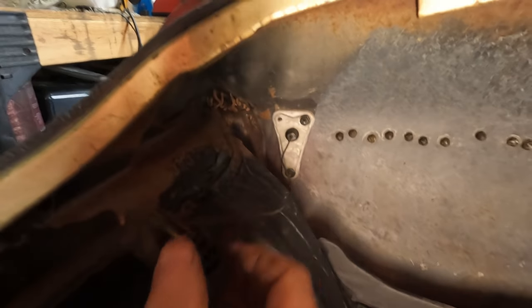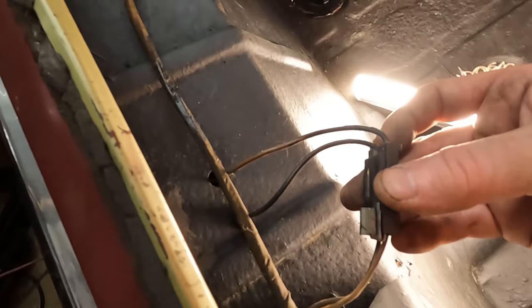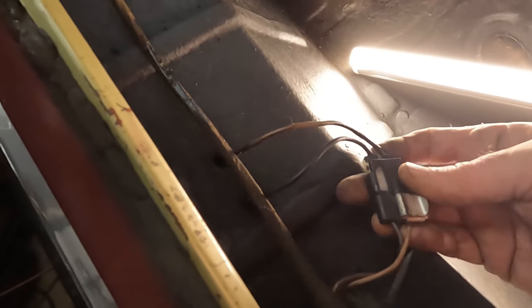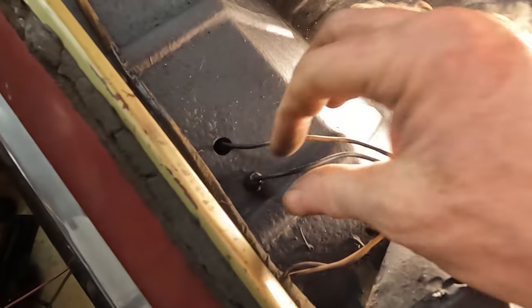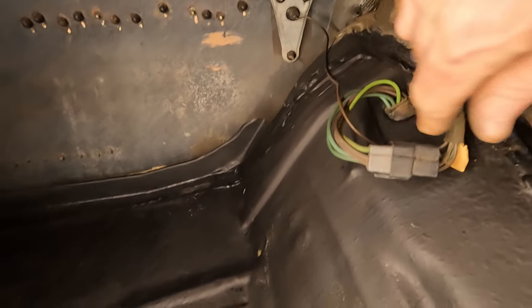This is going to the park light — there's one wire coming off of this. These are dropping down into the brake and taillights, coming along here and stopping at — I believe — the fuel sending unit. Along through here to the other connection for the taillight and brake lights, and then up to that parking light. So that's really all we have back here.